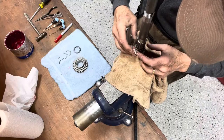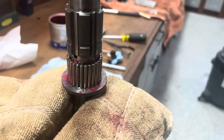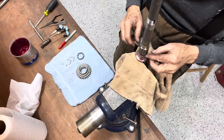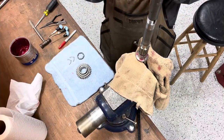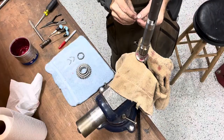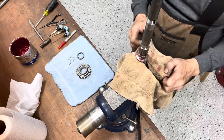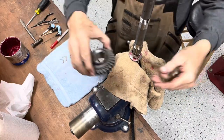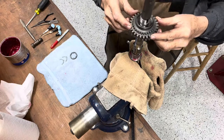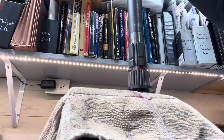Get them all nice and neat until you have them all on there in a nice neat position, then you'll be able to slip the bearing over the top. The next thing is to put the little spring and the two cylinders into the hole. I like to do it at this moment rather than after the gear is on there — it's easier. Be sure to put the two little cylinders in with the pointy smaller ends in on the spring; it's made to fit that way. Then line up those two cylinders so they're more or less even with the needle bearings, and simply slip the gear — this is second gear — over, lining it up nice and neat.